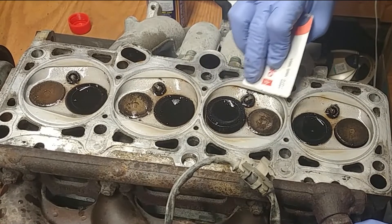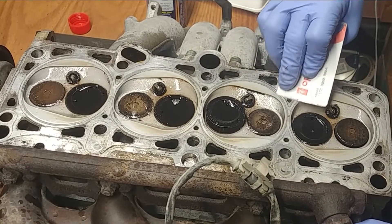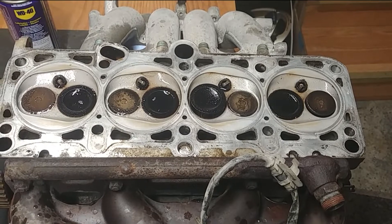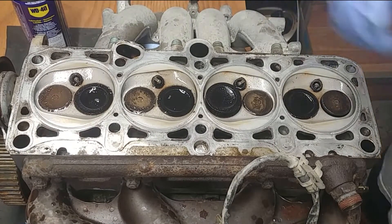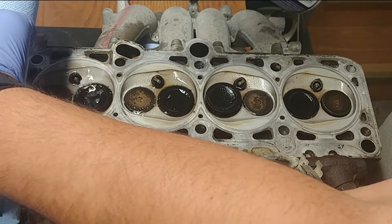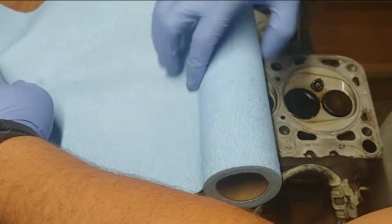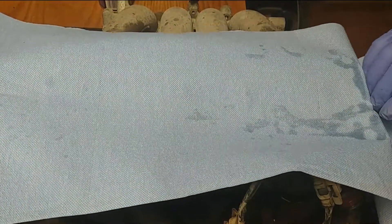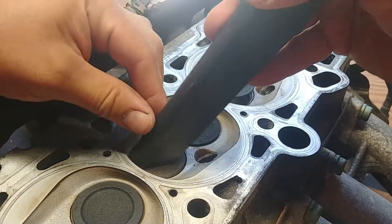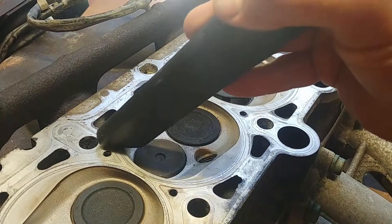Use the credit card like I'm doing — that's from the grocery chain — and keep the dirt out of cooling and oil system passages. Place clean shop cloths over the openings if needed. I cannot stress and emphasize enough how important cleaning is — if you do right cleaning and do a good job, that will always pay off. We're working on an aluminum head here. Spray WD-40, cover with a paper towel, let it soak, then wipe it out.